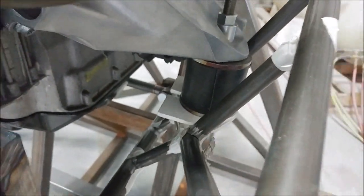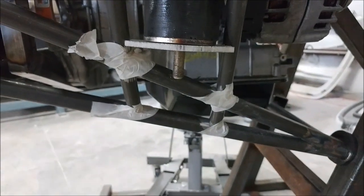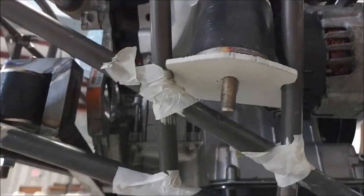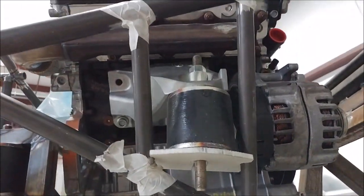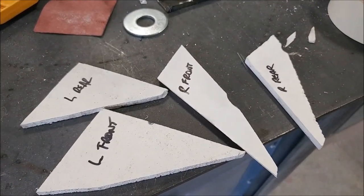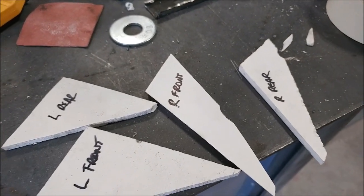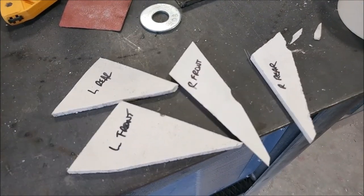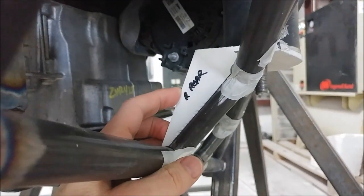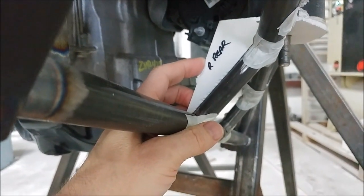After making that adjustment, I had to readjust the engine mount on both sides where I had set everything up. You can see now I've got the four pipes in place, along with a mocked-up mount — I'm waiting on steel to arrive tomorrow to cut that out. You can see two braces on either side of the flat plates to reinforce them. I've cut templates out of foam board to use for cutting the steel, and you can see how that all lives in there. It'll be cut from steel tomorrow, then tack welded with the TIG, and sent off to Brit so he can weld the whole thing up.